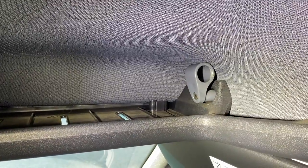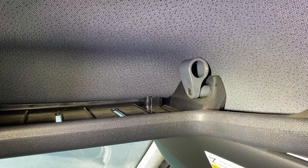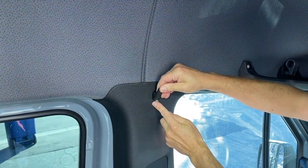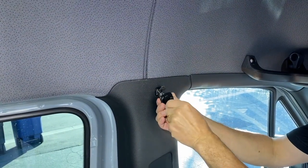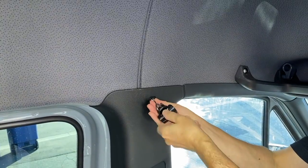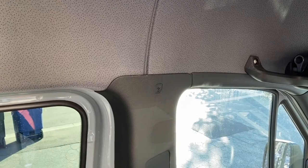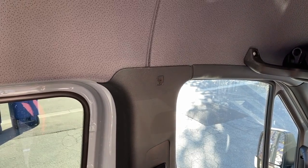The hardware works on both sides — passenger or driver's — and that's how it should look. On the driver's side coat hook, we need to remove this coat hook. Using a flat screwdriver you can pop that clip off. There's a little metal piece of Mercedes hardware — it's a T20. So we'll remove that Mercedes clip using the T20. You can discard that metal clip. Notice that's just a plastic piece you're threading into, so exercise caution when you re-tighten. When we say discard, just put the extra bolts and coat hooks in a box for later.